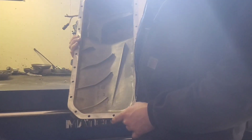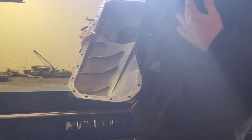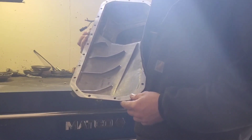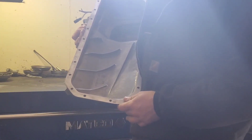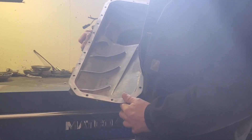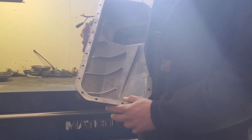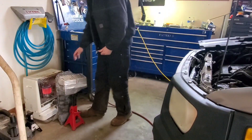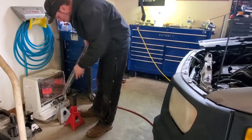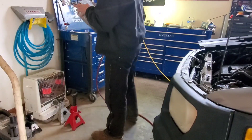First thing — it's extremely cold. It's the middle of January here in the South, and as you can see by my stylish attire it's pretty chilly. I've got a heater going in the shop. I'm actually going to put this pan in front of the heater and get it warm. Any sealant you use is going to work a lot better on something that's warm versus something ice cold sitting here like a popsicle. So, warmed up — good and warm.